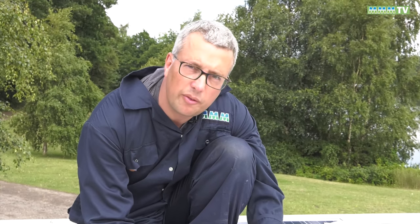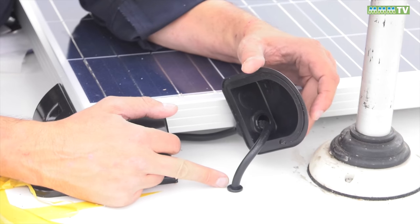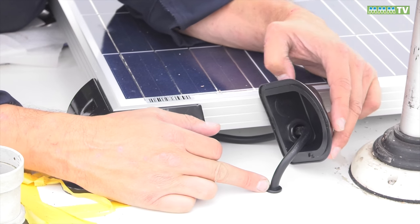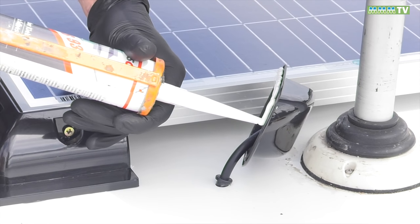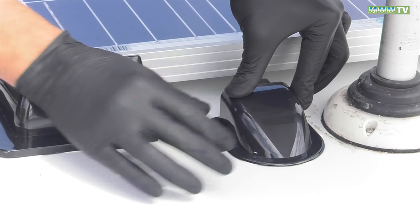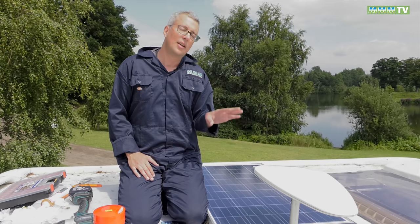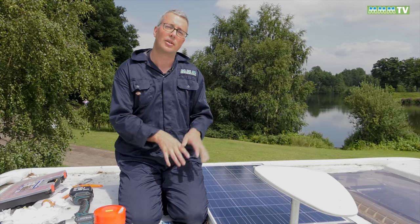We've got our solar panel in place now. We've screwed the solar panel to the feet and bonded all the feet in place with the sealant adhesive supplied by the solar panel manufacturer. We've got our rubber grommet in place — this will stop the cable wearing through and touching the aluminium roof. We're going to fuse it anyway, but it's just a bit of belt and braces. There's also an outer seal here and we're going to be gluing this cable gland cover. We've done all the external fitting. Everything's glued in place — just remember to tighten up that gland nut, but leave it all overnight to let all the glue set. Next we move on to the internal part of the fit, which is connecting the two wires from the solar panel up to your motorhome's wiring.